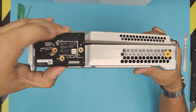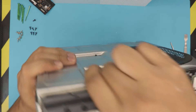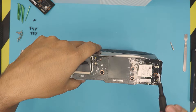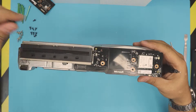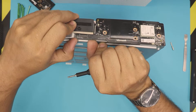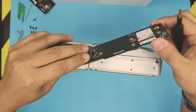Once you remove the screws, simply grab the Wi-Fi board, pull it up — there's a jack right there so just pull the jack up. Now go to the front end of the console. I'm holding this cover so everything won't fall off. Remove one, two, three, four black screws — all the same size. Now don't lift it up from the wrong end or you'll break it. Put your fingers right underneath and pull it up from here carefully, since pulling from the far end will bend and break the board.